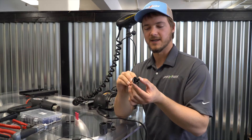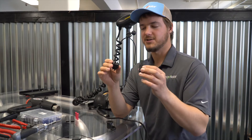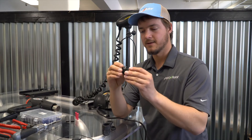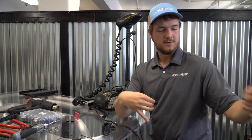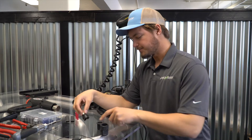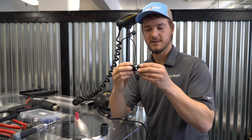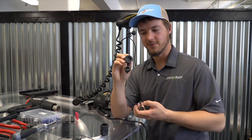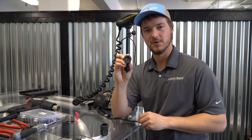When you get one of these plugs and open the packaging, they have very specific instructions on how to wire the plugs for either a 12 or 24 volt trolling motor. You're going to follow those instructions to wire the trolling motor power cord directly into this type of plug. The opposite side of this plug is going to flush mount in the front of your boat on a flat surface where you have quick and easy access to connect that trolling motor.